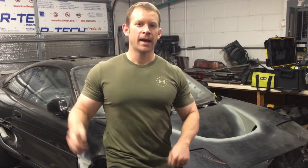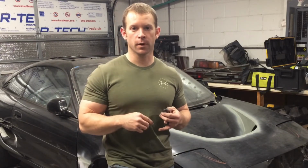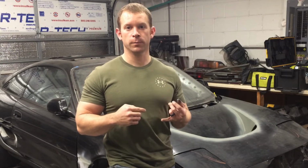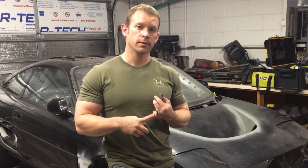Alright, I gotta say I'm pretty happy with how that aluminum work turned out. I still have to finish the metal a little bit. I left some straight marks in it from all the tool work. So additionally, we've made a radiator fit with making the rad support. We made the radiator flow with cutting the vents through it and making the duct work.